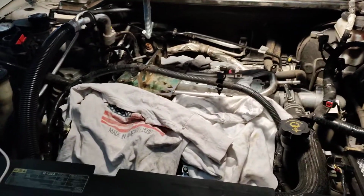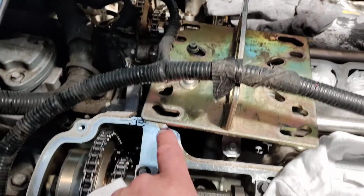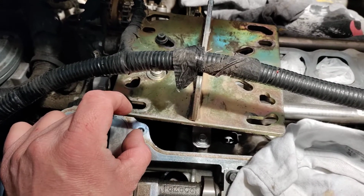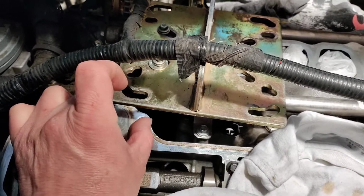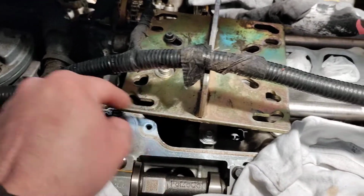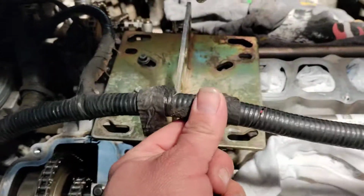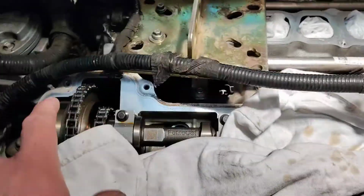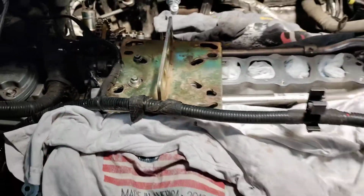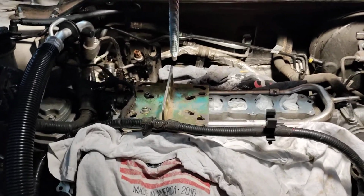Just to go over some of the notes, make sure on the valve cover bolts, you're going to have your little plastic zip tie, I'm trying to figure out what to call it, connector or whatever, that holds your wiring harness. Bottom line is you're going to have to break those to remove your wiring harness and then unscrew them off, because they're threaded onto those studs there. No big deal there. Just go buy a new pack. They're not expensive at all.